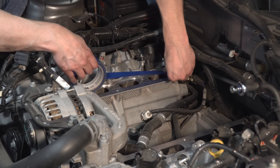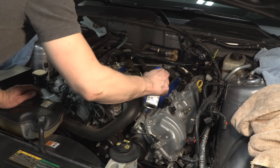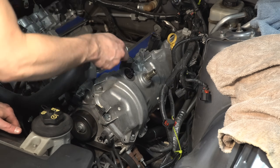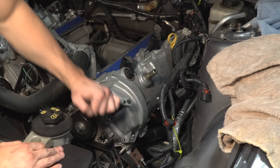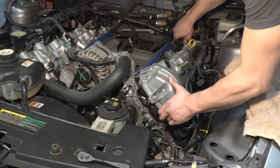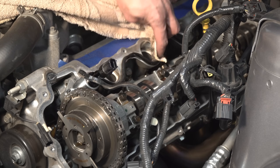Once you're done cleaning, cover the intake holes with masking tape. Use compressed air to blow away any debris, especially around the inner side of the valve covers. Loosen the driver side valve cover bolts with an 8 millimeter socket — I highly recommend having power tools because doing this by hand is tedious. Remove the driver side valve cover. Remove the valve cover gasket, but be sure to clean up any debris that could fall into the valve train first.